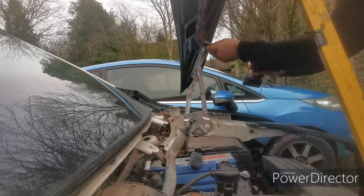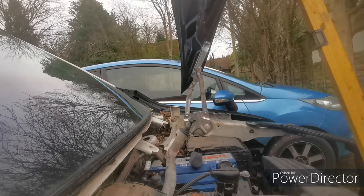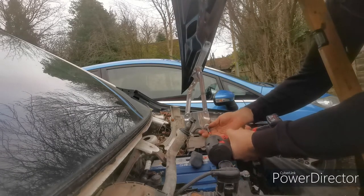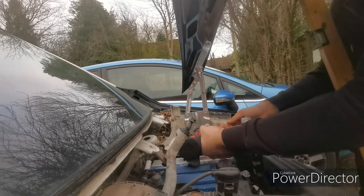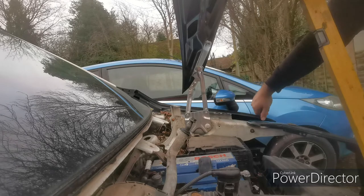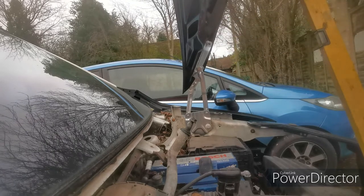These back up. Now these are not going to be in exactly the right place. And if it's tight, we know it's not going to fall. We'll do all the panel adjustments at a later date when everything's on. There's no point trying to line panels up at the minute, because for all we know this is going to have to move. It's going to have to move, so we'll just get it all on for now, bolted in.